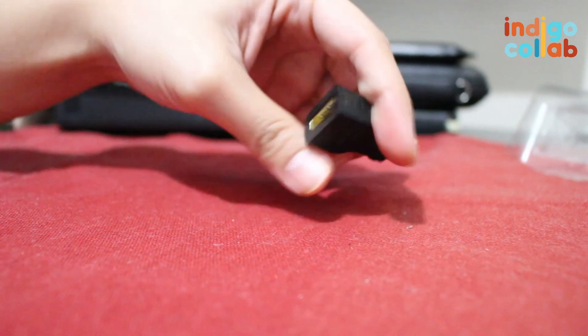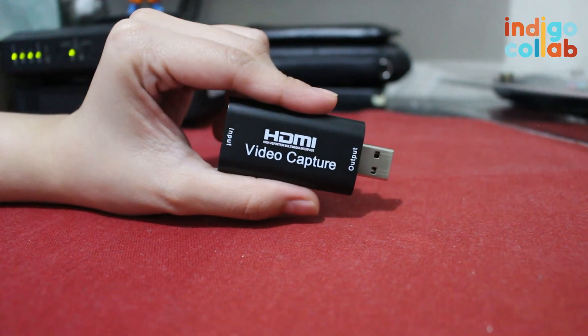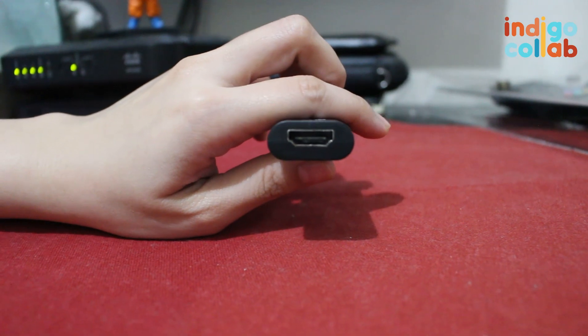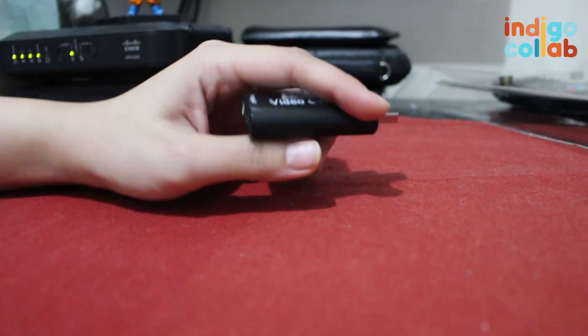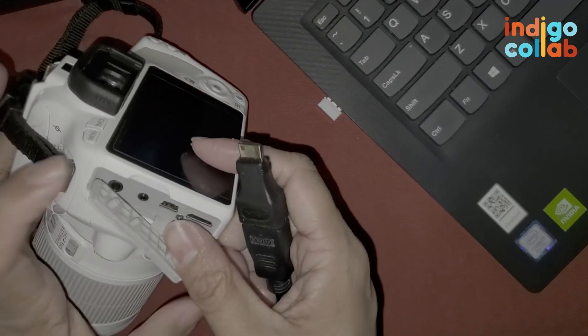The second method would need three devices. Most DSLR cameras are compatible with mini HDMI. So you would need a mini HDMI male to HDMI female adapter, and of course you would connect it to an HDMI wire. The other end of the HDMI wire goes to an HDMI video capture device. It has a female HDMI port and a USB stick that you can plug into your laptop. For this one, you choose the HDMI female port on your camera.